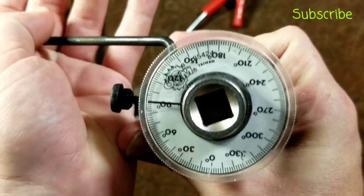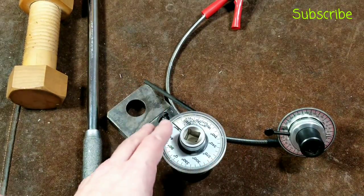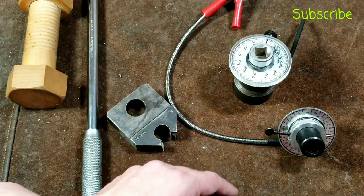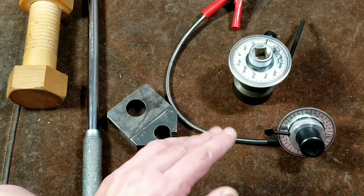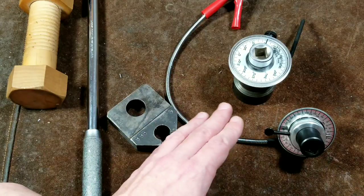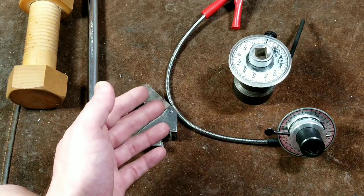Then as you torque, you start turning it and watch the gauge go up until you hit 90 degrees, and you know you're done. It's really super easy — all you need is a breaker bar to do your torquing. It obviously doesn't work from just putting on a part and immediately applying a torque angle, because torque angle is really specifically calculated. You need the parts to basically be seated together first for them to have any meaning. That's why you still need normal type torque wrenches.